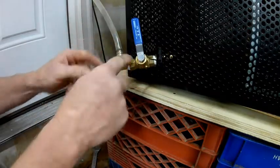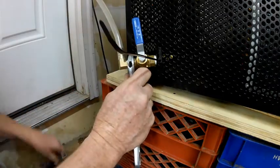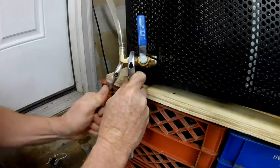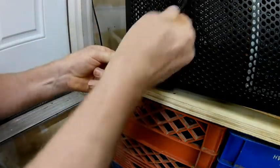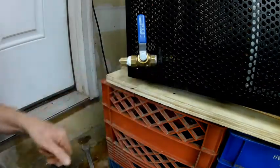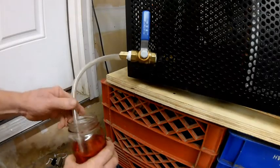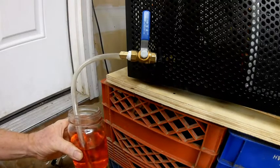I want to make sure I have enough movement. This is actually going up, so what I should do is give this another little bit of a turn downwards, because my valve is going to be up in the off position. I just want to turn that down towards the back like so — that way it goes exactly where I want it to go. I've put this back into its slide. I've run my freeze dryer for a few minutes, so we're going to go back to the test here. And no leak.